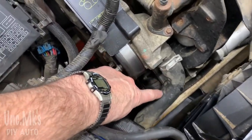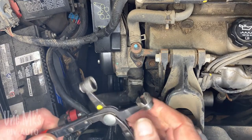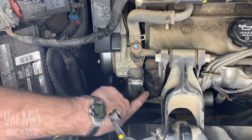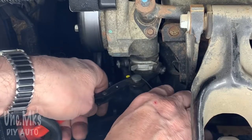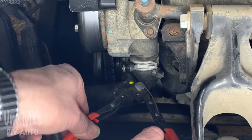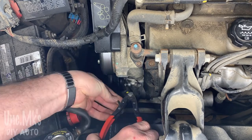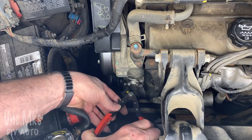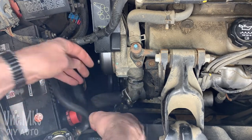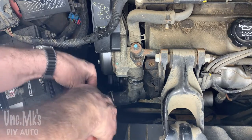This hose has got one of these clamps — these are always tough to get off, put back on, or move around. There are special pliers made just for these; I highly suggest you get one. You can see how it works: the flat side goes in, and this one is like a cup that goes on the finger sticking out. Link in the description for this tool. As you squeeze it, it snaps and locks. Then you can just move the pliers, squeeze a little more, and they stay on there really well.